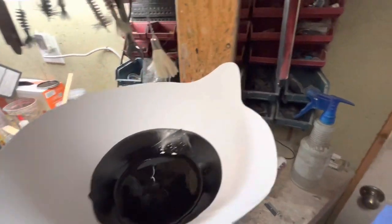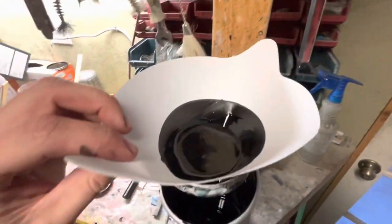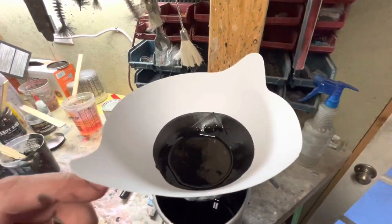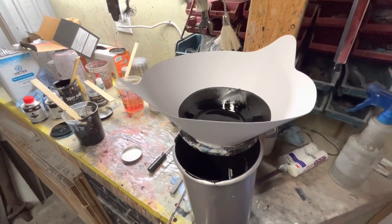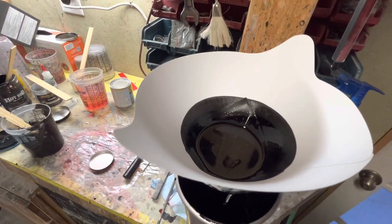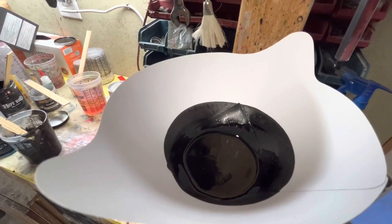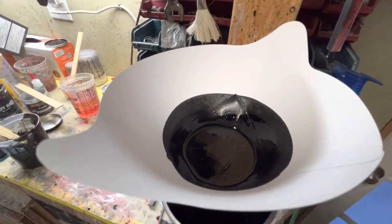So I'm just going to strain this out. And we might have to switch strainer sometimes where you can shake it up like this. But yeah, this is going to pull a lot of chrome flake out so that hopefully the next coat is a little flatter. The chrome flake and this orange peelness does help hide the rough spots. So in this situation, it is good for the job and it is a good choice. But I still want to be happy with it. I don't want it to look like bedliner.